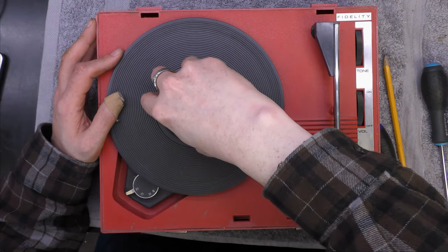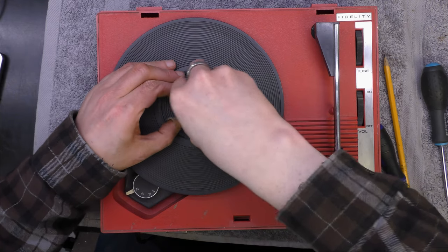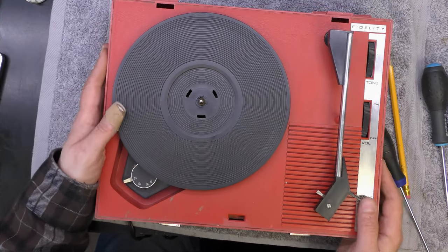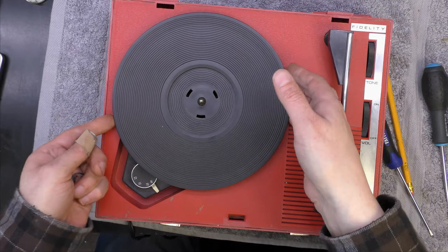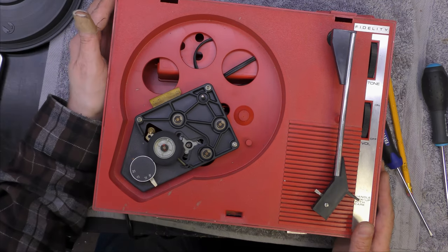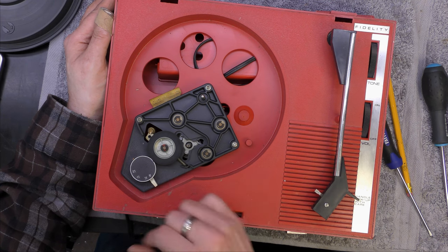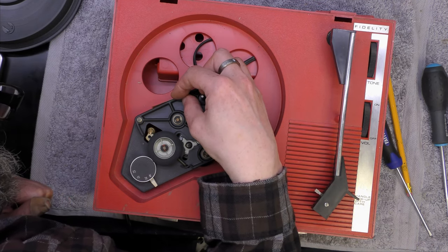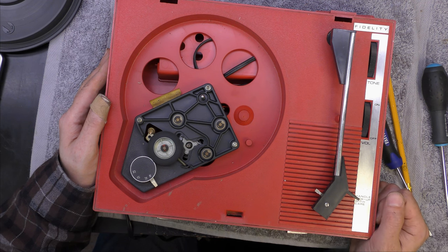Starting with removing the 45 adapter - I'm going to be very very careful. The last time I removed one of these I broke it. Thankfully it's come off in one bit. Let's take this clip off. In neutral so the wheel should be out of the way. Very very simple isn't it. Here's the mounting for the motor, there's the idler. I suspected this is a BSR deck - there's some technical information there. Model M100. I can now release the clips, get the motor out, and work on that first.